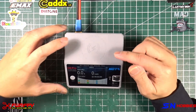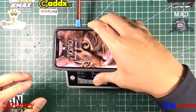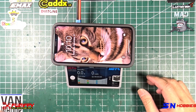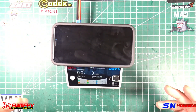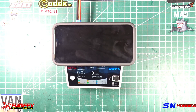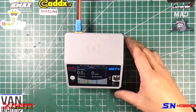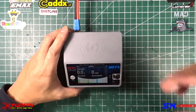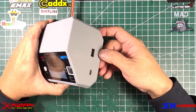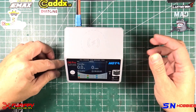One of the features of this charger is wireless phone charging. You can wirelessly charge any phone that has wireless charging capabilities. From my research, I think it's outputting 5 watts wirelessly. I tested it — this is an iPhone X — it charges about 1% per 5 to 7 minutes, so it's not as fast as wired charging, but it's a good feature to have. On the side it also has USB at 2.1 amps, so if that's not fast enough you can plug your charging cable in there and draw 2.1 amps. There's also a micro USB port, which I think is for firmware updates.